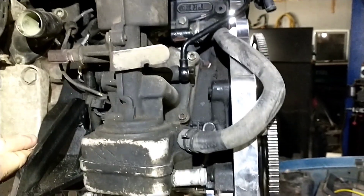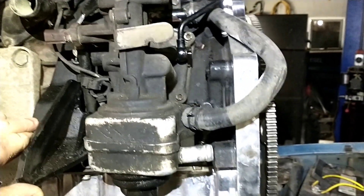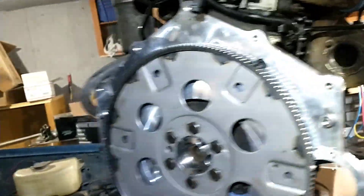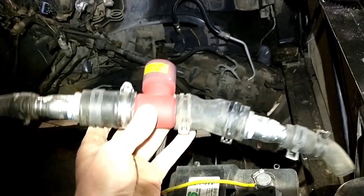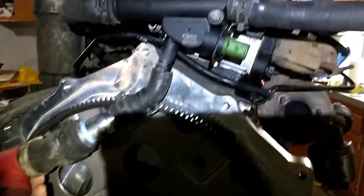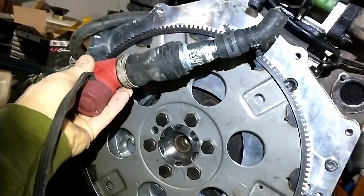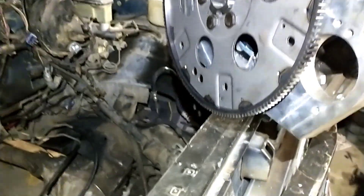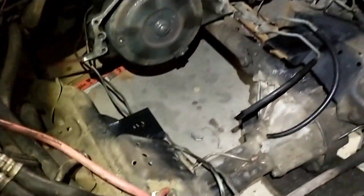Had to work on the oil cooler lines because I cut that black pipe coming out the back, so we just put one side right onto there. I'm also working on a block heater — it's going to be a little bit of a messy contraption, but it is an inline block heater, basically, since these Volkswagens don't have any freeze plugs. It's going to go right here on the back side, curve around and plug in, laying on top of the engine. Quite a bit of fittings to get it all adapted from inch-and-a-quarter down to five-eighths, but I think I got it. I'll include some pictures of those frame mounts so you can see those.